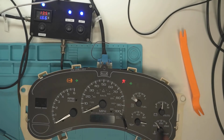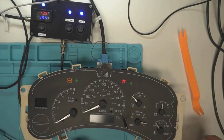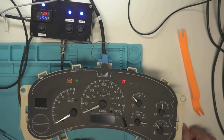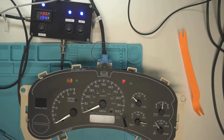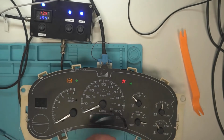But yeah, that's definitely, that one's bad. That one's good, good, good, good. Yeah. This is the only one I would consider either oiling or replacing on this one. That's kind of your judgment test on these: are they super bouncy? Okay, I should consider, you know, oiling this for the customer if they weren't complaining. Because they may not have complained that it was a problem. And so if it wasn't really a noticeable problem for them, there's no need to actually replace the motor. Just oil it and get them back on the road. So that way you can save them money.